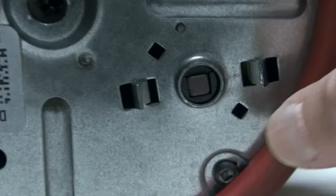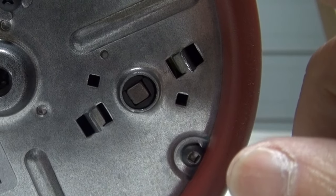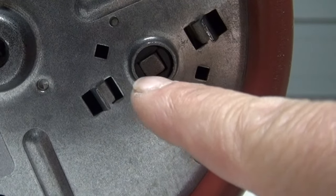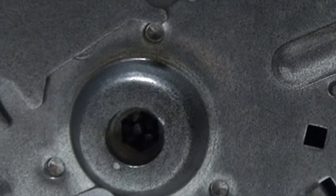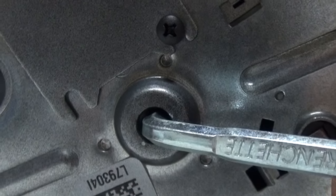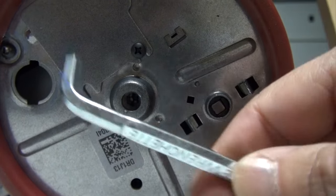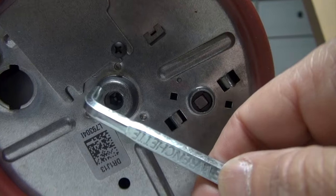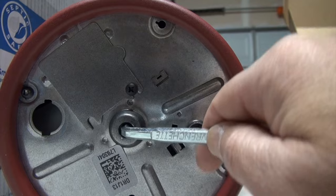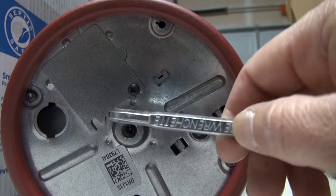Here at the bottom you have the reset button. So when your disposal is not working and you turn on the switch, it might have tripped — you just have to reset it by pushing this button. The other piece here in the middle: sometimes you have big particles in the disposal and the motor gets stuck. You just need to plug this in — it's called the jam buster or something like that. You can use this to manually move the motor whenever the disposal gets stuck to make it work again. If these two things in combination don't work, then you need to either fix it or get somebody to fix it.